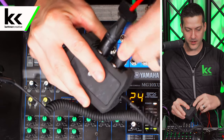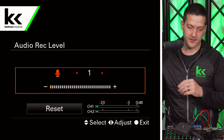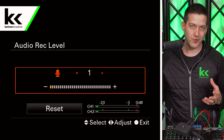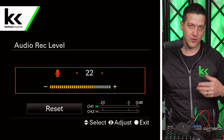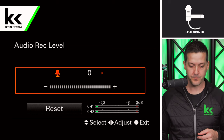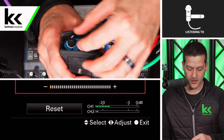Now we're going to open up the audio settings on this camera and go into audio recording level. When you set up your recording level on your DSLR video camera you want to set it to the lowest possible setting. The preamps are no good on these small DSLR video cameras — you don't want to be up around level 15 or 20. You'll get a great amount of hiss and static and bad quality audio. So let's turn this camera all the way back down to one, then grab the audio interface and as I'm speaking I'm going to turn it up to about 50%.